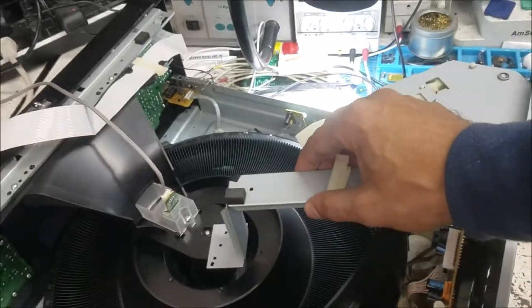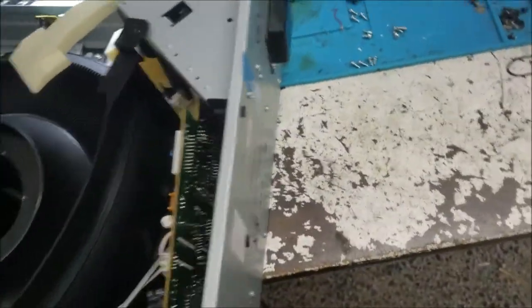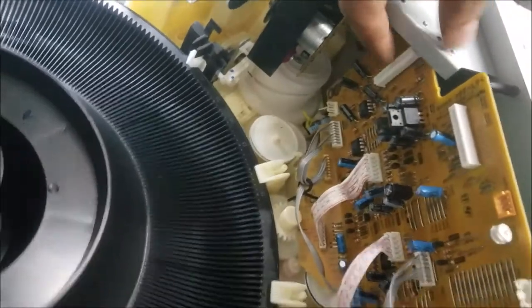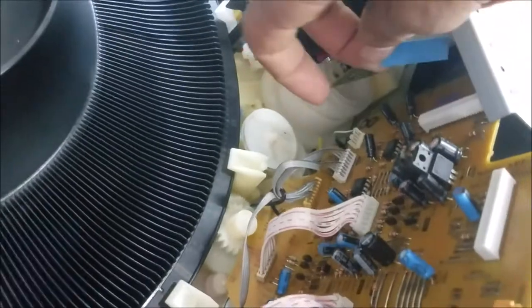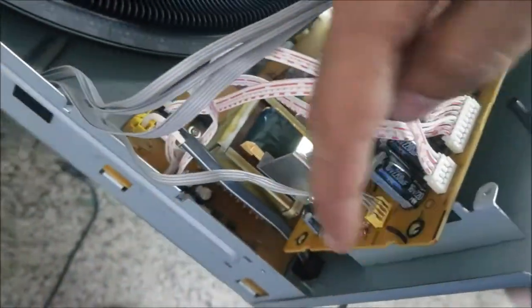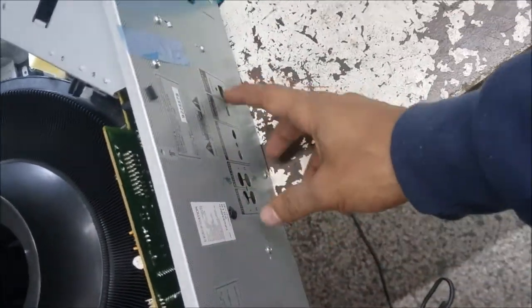To reach the belts, you're going to need to remove a screw and remove this mirror piece from here, remove another screw and remove this plastic piece, disconnect a flex cable here, disconnect this cable here, and unscrew these four screws for this board, then unscrew this one here and take out those screws.